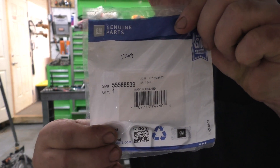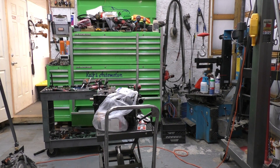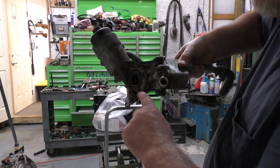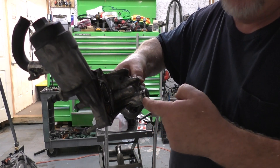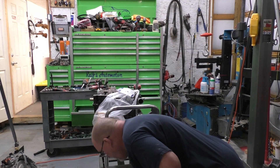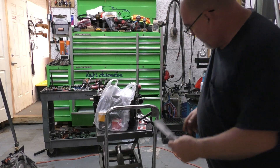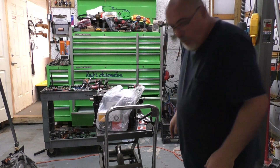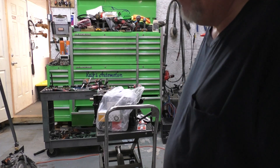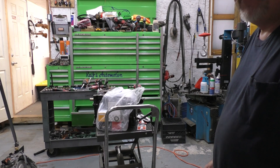This is the gasket for the oil filter housing — completely flat. There's an O-ring here that's also readily available. It may come with your head gasket set that you ordered. This one is going to get a Felpro head gasket set, 100%. I did a comparison and honestly I thought GM was the way to go, but I think Felpro is one up on them. This is my opinion.